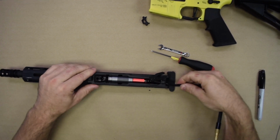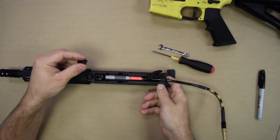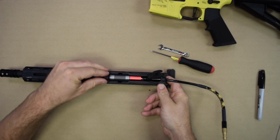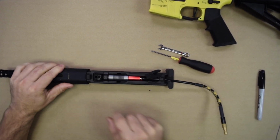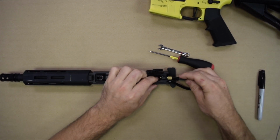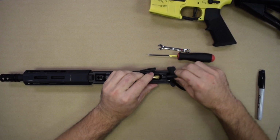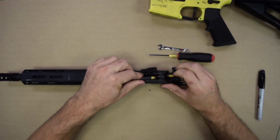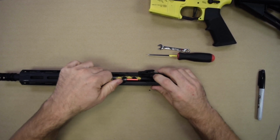Okay. Next thing, we're going to push the cylinder forward at the back until this clip can pop into place, like so. Finally, we're going to thread our airline back through. Again, it goes fitting end first. We're going to be careful to avoid catching our heat shrink on the edges as we go through.